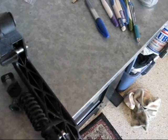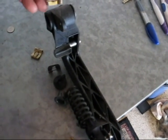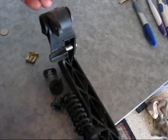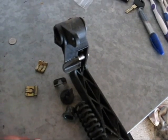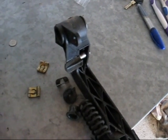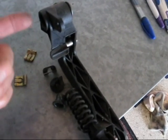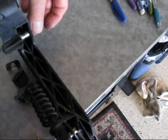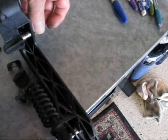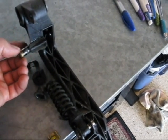You can wiggle this to the right if you're upside down — it's to the left if you're sitting in the driver's seat. The clutch shaft connection is flexible; it has like a universal on it, so it'll move around a little bit. So you start wiggling this thing to wiggle it off the top. The top pin stays there. This is the clutch master pin here, and that's what you want to get out, just by wiggling the top to give yourself some room. Then you eventually wiggle this out.